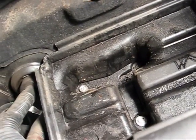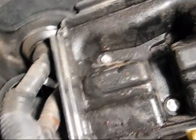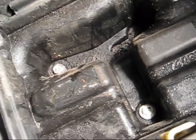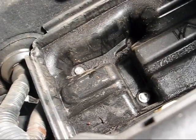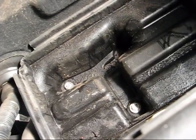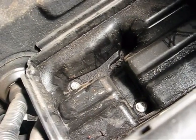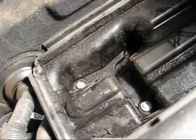Battery's out, and here's what I suspected to find. You see all the wetness? You see the corrosion around those hold-down nuts? All this battery acid was going down underneath into the tray. I'm going to see if I can get the tray out, and then what I'm going to do is neutralize it with baking soda and water — just mix some up and splash it everywhere I can. That will neutralize the acid. Otherwise, that acid will sit there and keep eating into whatever it touches. If it touches metal or wiring, that's bad.